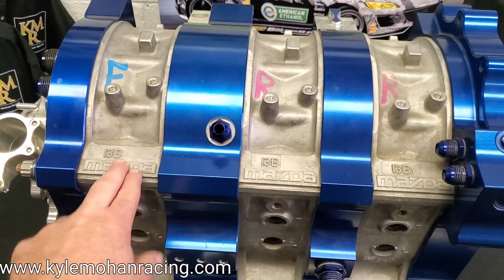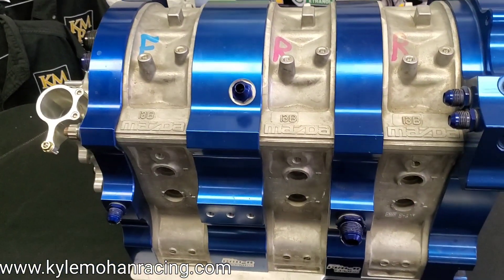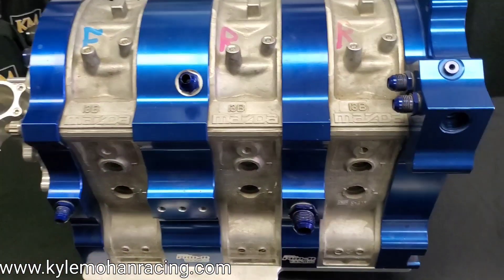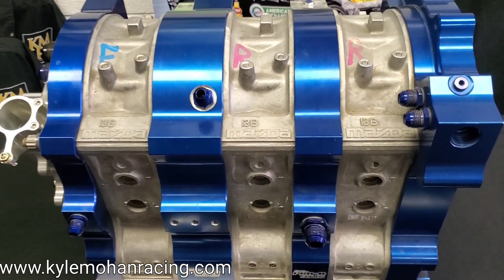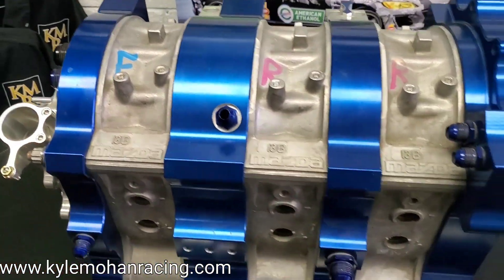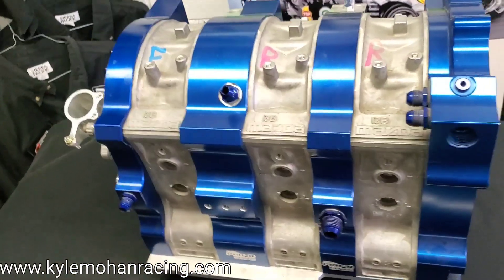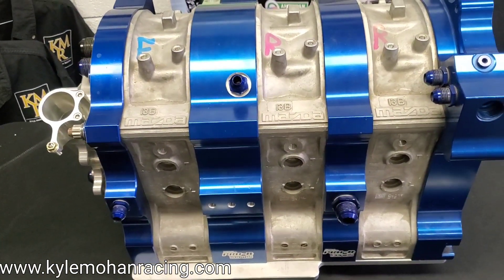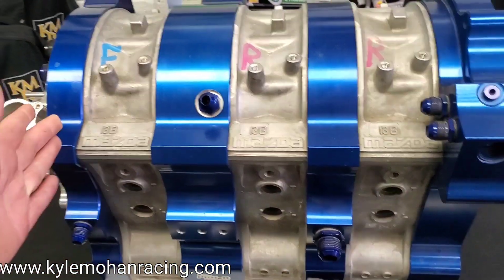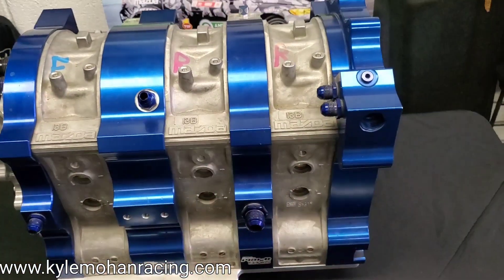As you can see right here, we're actually using 13B rotor housings — we were able to get those. These are Series 5 turbos and they were on the inexpensive side by comparison to some of the others. Once you've done the machining, the blocks are fully studded. It's about using your money wisely and achieving the goals you want out of your rotary engine builds, so you don't always have to use a 20B rotor housing in a 20B motor — those 13B components will work.